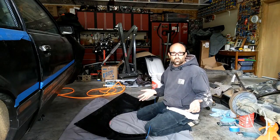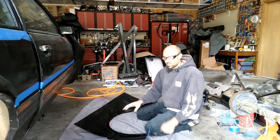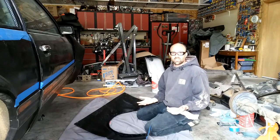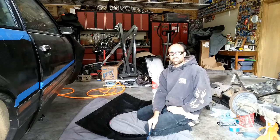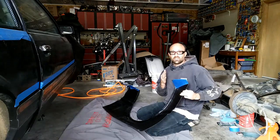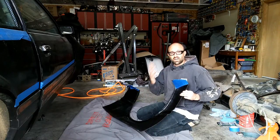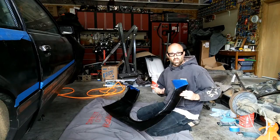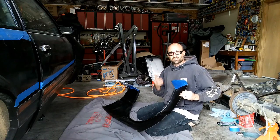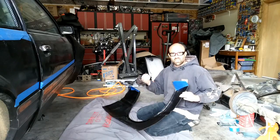With the fuel filler outline done and knowing where it goes, I'm going to start working on fitting the panel itself to the body. Along the edges this is going to fit very tight to the body line because the mold was made from an actual fender, so it should fit tight. The place I know needs material removed is going to be along this bottom. I've used blue painter's tape on the inside - just to have a non-black surface to mark against with a Sharpie. I want to put the fender flare up, clamp it in place, mark with a Sharpie to get a rough estimate of where I need to cut, then use a cut-off wheel to get it close and start fine-tuning so all the contours fit flush to the body.